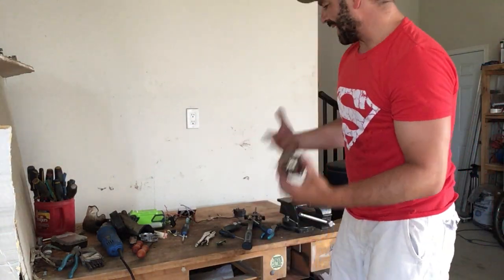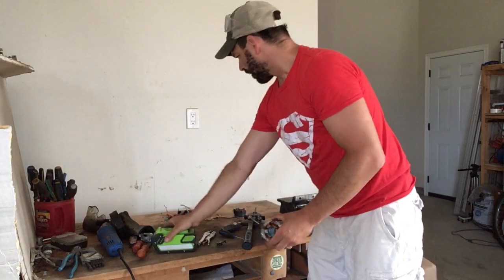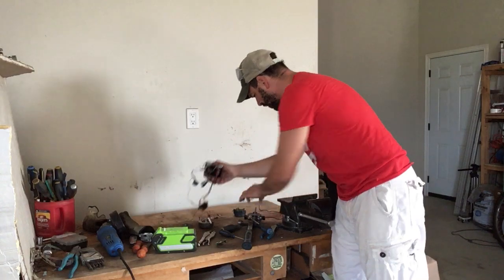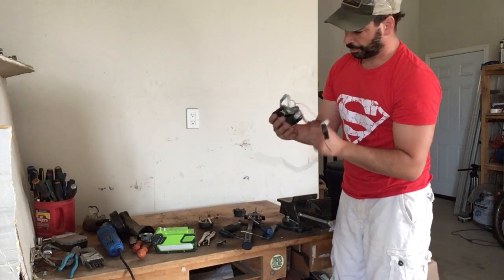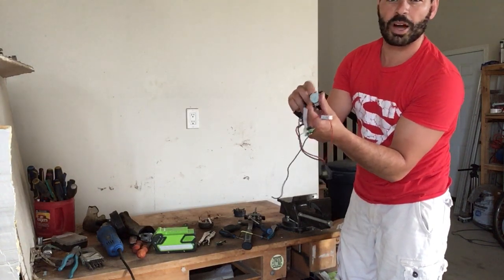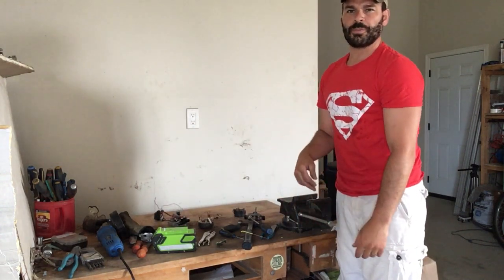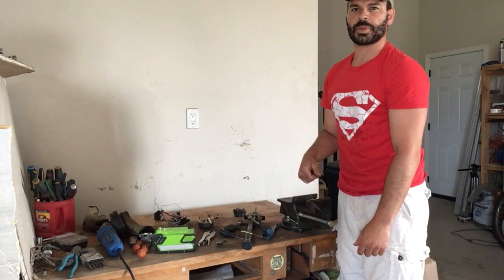So all in all, great piece of appliance — very easy to take apart. I've got my lithium battery that's going to be recycled properly at the scrapyard. I've got number 2 copper from my copper bearing motor. I have a bunch of low-grade copper wire. I have 2 silver contact connector pieces that have silver. I've got a really nice aluminum heat sink. There's also a small little copper bearing motor right on the knob — this one I'll just throw into my copper bearing motor bucket because it's so small. This took me about 15 minutes to take apart. So all in all, great find — another electronic diverted from the landfill. Hope you enjoyed this video. Please comment down below, like, share, and subscribe. I'll catch you on the next video. Tin Man out.